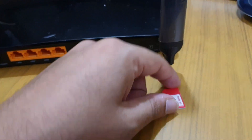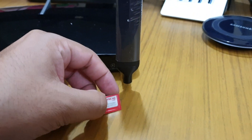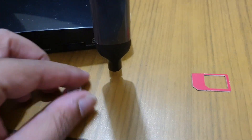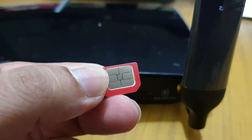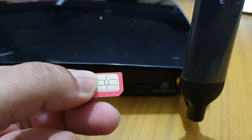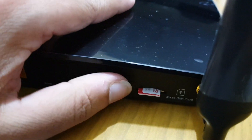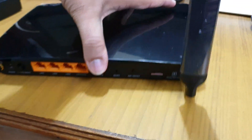The antennas are tight. Now we have to put in the micro SIM, so we need to pull the tray out — just press it very carefully and it comes out. This has been converted to a micro SIM slot. Just go ahead and push the SIM inside. Do check that the contacts are totally clean; don't insert it if you have any fingerprints or dust on it — clean it first. Then push it inside and you will feel a click, and it's locked in.